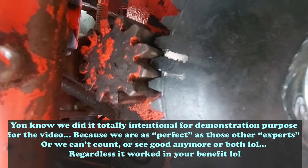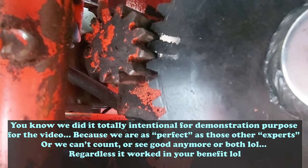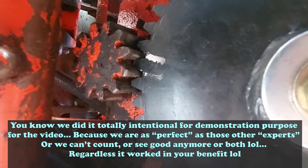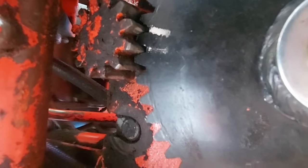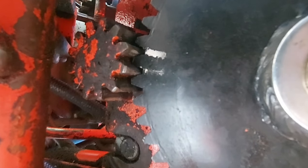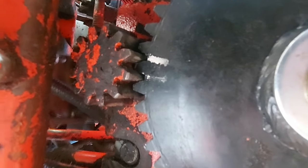And we initially set it off a tooth. So if you're turning one way or the other, this is the way to correct it. You move it one tooth, one direction or the other. A lot of people complain about them turning better to the right than the left, and they do a little bit, but it shouldn't be very noticeable. If it is, somebody's monkeyed around with this gear and doesn't have it installed right.